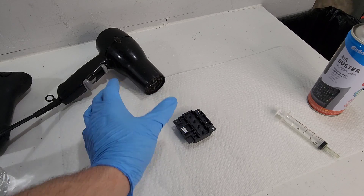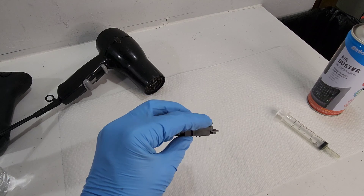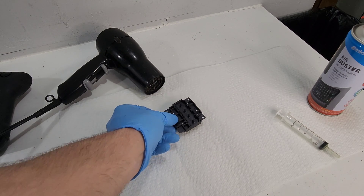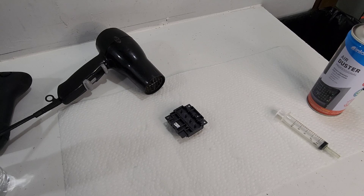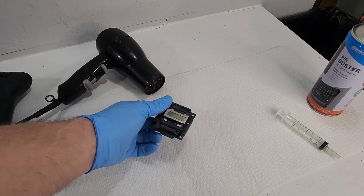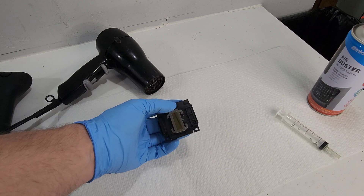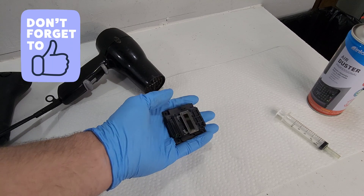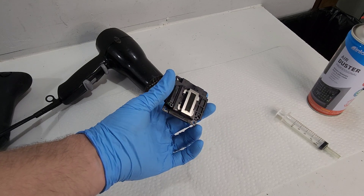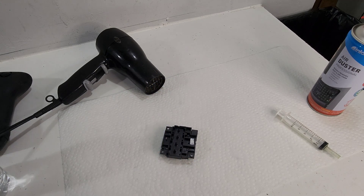After you're all done with that, the most concerning part is this connectivity port — make sure it's dry before you install it into the printer. Once it's dry, you're ready to load it into your printer. That's how you clean this printhead — very similar to most Epson printheads, this is more of a simple one. Hopefully you are able to do it; it's mostly going to be a successful thing. Good luck, check out our video where we show how to take it out of the printer in the link below. Thank you so much for watching, have a wonderful day.